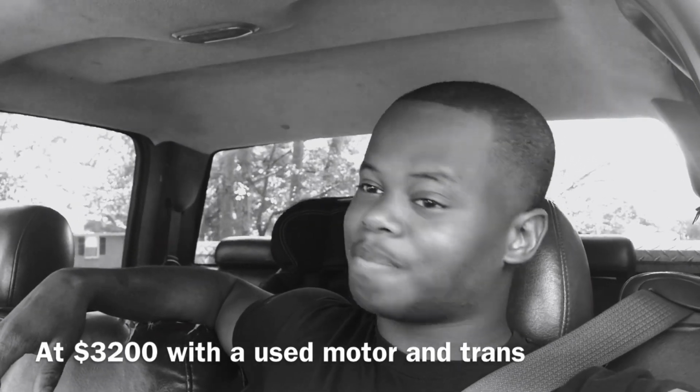So I'm waiting on the last batch of parts. I'm trying to make this a clean turbo swap. I ordered a last bit of parts, man. I ordered a serpentine kit and an LS1 water pump. I got the water pump though. The serpentine kit is basically a bracket to relocate the alternator and power steering pump to make it not look like the truck. Belts, all kinds of little stuff. I'm waiting on that last batch to come in.